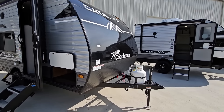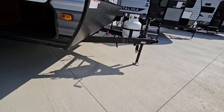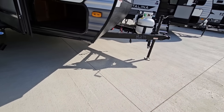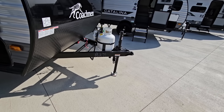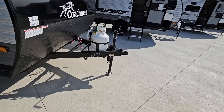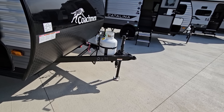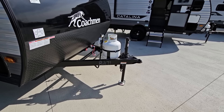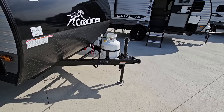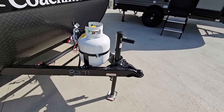Taking a look at the front of this unit and working our way back. You can see that this rides on a BAL frame. This uses huck bolts and it's kind of a stamped frame versus a traditional I-beam frame. The folks over at BAL claim that this frame is stronger because of how the bolts connect together and it's more serviceable. I don't know if it's actually a better frame or not, but it's a different style frame and BAL makes quality products, so this would probably be a pretty good frame.